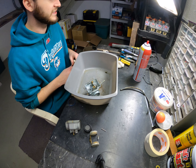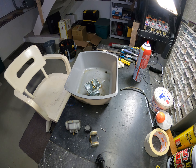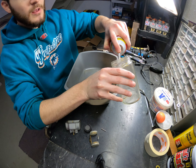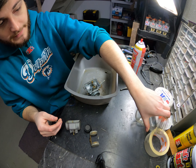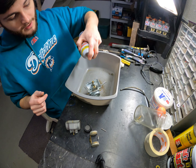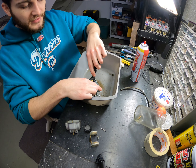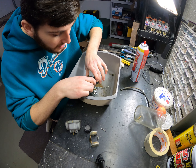Usually what I do is have a glass container on the table. If you have an old glass container like this, you can spray a little carb cleaner in there and just let that soak — it will eat all of the junk out of there. I also do a little spray in here to clean out this section. Take your brush — soft bristle, nothing metal — give that a dunk. That looks pretty good.